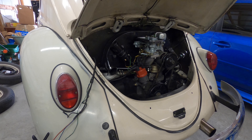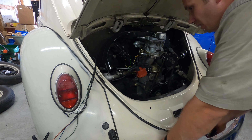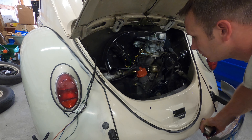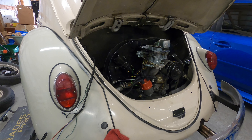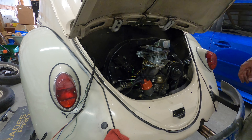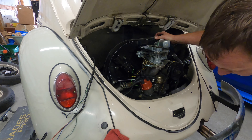Theoretically everything's good — cool thing about this engine, it was hanging on by three bolts instead of four. Try to grab onto the exhaust, and if it doesn't budge at all, try giving it a little push up with the jack. It was a bit of a pain — I ended up having to tip it down to get it clear of the back two studs, the two mounts to the transaxle.